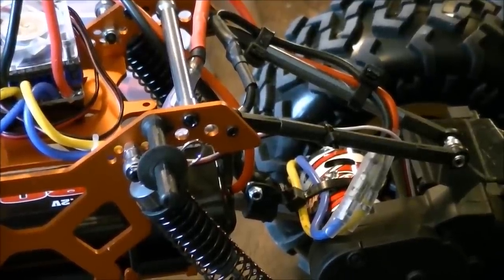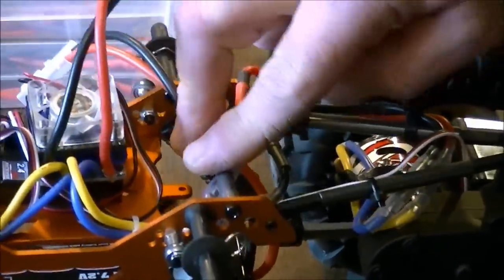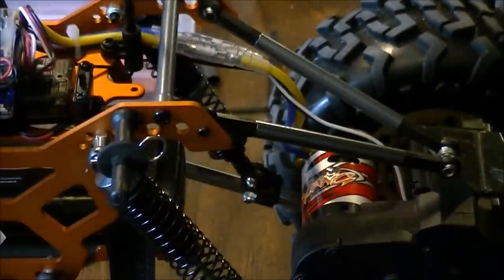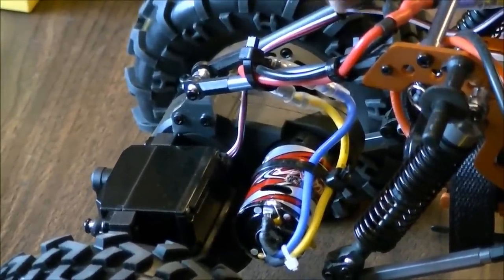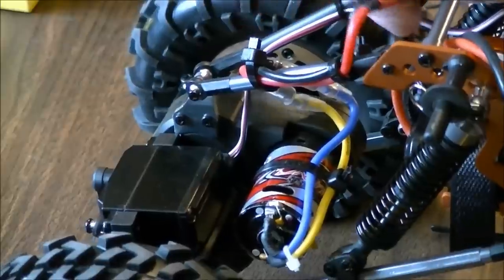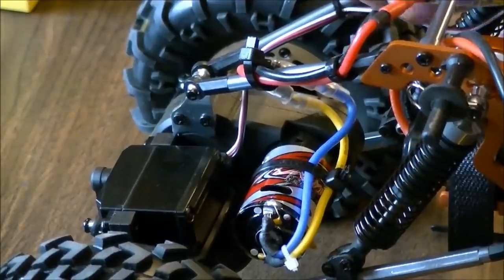Okay, our front side is now completed — all tie-strapped and routed. I was able to pull the wires back a bit towards the ESC to give them a little more slack so they're not so tugged. Now we've got full flexibility all the way down without hurting anything. I also moved the servo wire to the other post, routed it up through and around and inside, and double heat shrink tubed everything, so it's definitely going to be secure — no worrying about anything shorting.